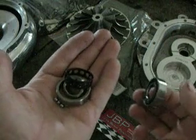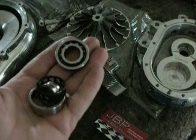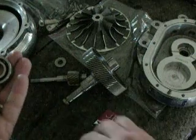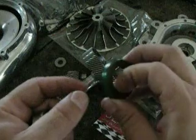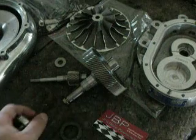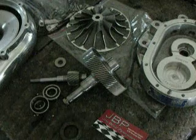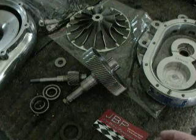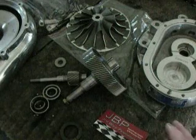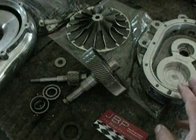What I recommend to Tudor is we're going to replace all the bearings in this — they need to be matched. And while he's at it, since he's gotten this far along, he's going to go ahead and replace the input shaft bearings as well. This is the front oil seal, and it was seeping — it's very hard and brittle, so it pretty much needs a new front oil seal too. So Tudor, that's what we've got. Hopefully you found this helpful. For those who have never seen one of these apart, pay attention, because I may post some information on assembly here to show you how to properly put it together. Keep watching.